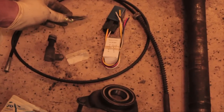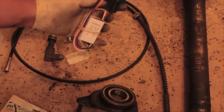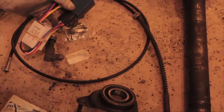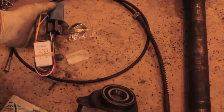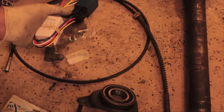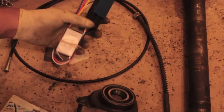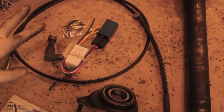These are some green indicator LEDs for our overdrive light, much like the 240s. And much like the 240, we have a relay — this is the blue overdrive relay from the early overdrive transmissions on the 240s, I believe 1986 to 1988. It's smart enough to know that when you push the overdrive button it activates the relay, so you don't have to have a constant on/off switch. I got this relay because I want it to shift just like it does with the 245 that I have over there with the M46. There's a pigtail for it and we're going to wire it all up. I've got some diagrams online and I'll put all of my resources in the description.